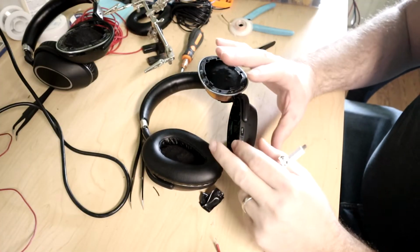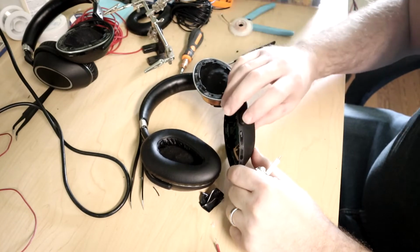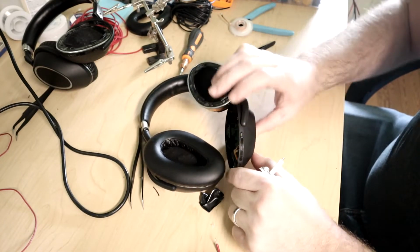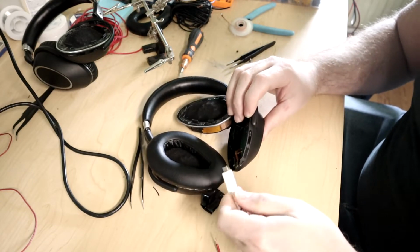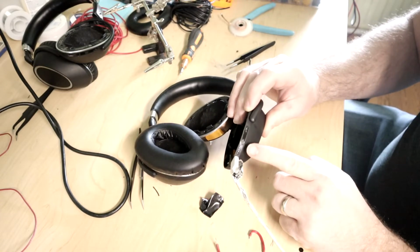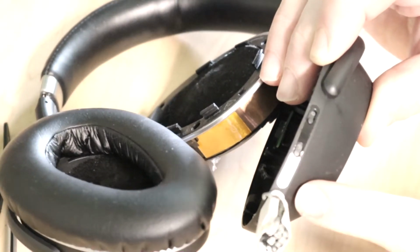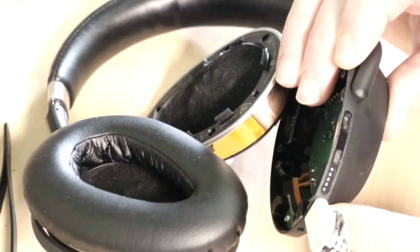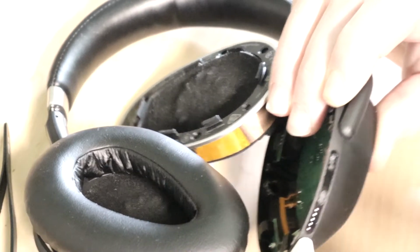All right, so now turning focus over to the other headset. Remember, it won't power on, but also has this button down here that is stuck. One thing I did notice, though, when I plugged this thing in, remember it's micro USB, not USB-C, I get this combination of lights. Here, let me zoom in. A combination of lights where all of them are basically on, and it doesn't do anything from this perspective.